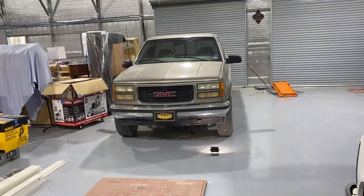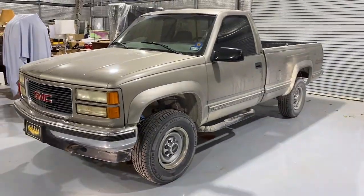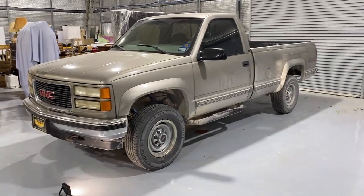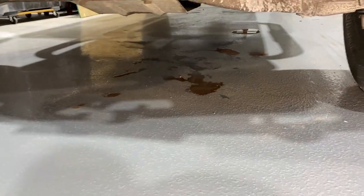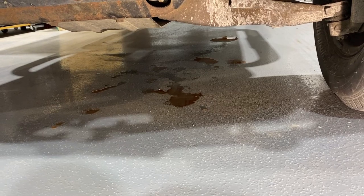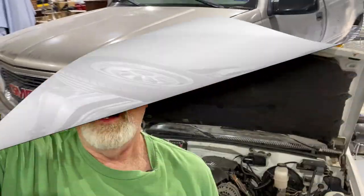There are probably a number of people out there who'd like to see that repair. Let me show you why it's become a higher priority to change those manifold gaskets and the water pump. Here's the truck — I apologize for it being dirty; I live two miles off a paved road so I can't keep anything clean. Looking underneath the truck, that's a lot of coolant to me, and it didn't take long to accumulate — about two days. So that's something that's got to be done soon.